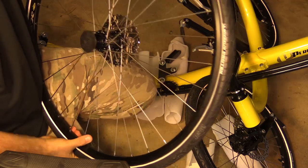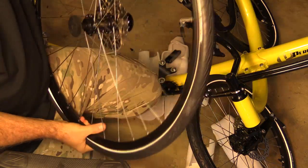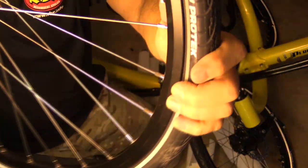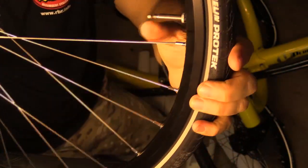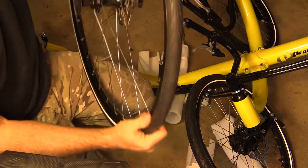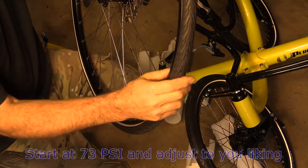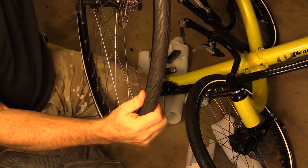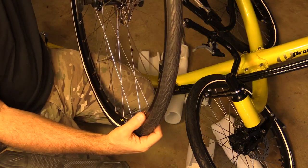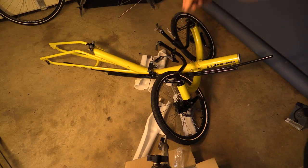As of March 2017, the JC70 is shipping with the Michelin Protex City Tire — a pretty darn nice, grippy tire. Mine had a little bit of air still in them; they come with a Presta valve, so be sure to tighten that little screw at the top. The pressure range is 57 to 87 psi, putting median inflation right around mid-70s — about 73 to 75 pounds. Lower pressure gives a softer ride with a little less efficiency; higher pressure means easier pedaling but potentially less grip.